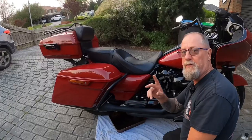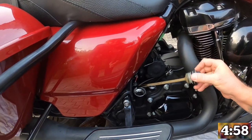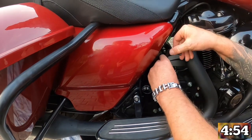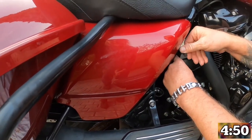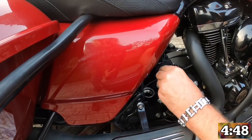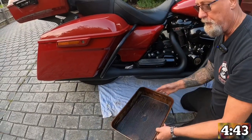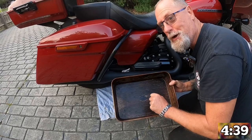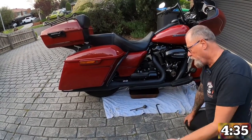Let's do it. First thing we're going to do is remove the oil cap, set it aside, and then remove the transmission cap — set them both aside. Whatever you're using for a pan, the wife's baking tray works a treat. Now we're going to drain both of those from underneath.